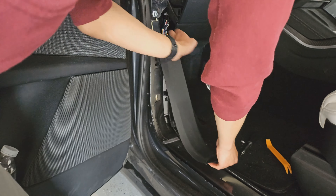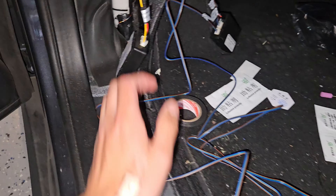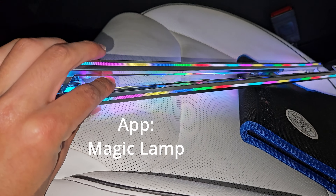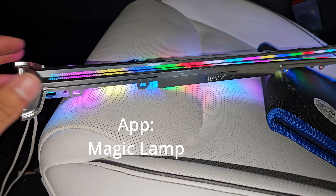You're going to have one splitter in the kit, and you'll put it in between the OEM connection. The splitter has a fuse in it which goes to our receiver — the receiver is what's in this big part right here. There's a black cable that gives it power, and then this other little white plug should be empty — we're going to plug this splitter into it, and it goes out to a fuse and then to our transmitter. You can see there's a green light in the transmitter — it's on and connected.